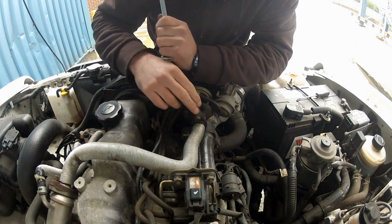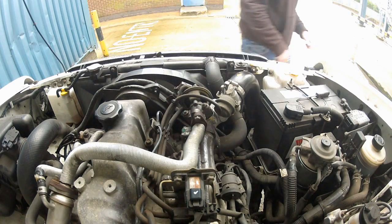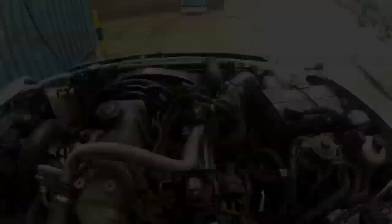Right, that's about it. And now you're preventing all the sooty exhaust gas from re-entering the inlet manifold. Congrats. You may even notice a slight improvement in engine performance too, which is always a bonus. Now, one problem you may encounter if you're doing this to a more modern vehicle is that the fancy onboard computer system is going to know you've done this and may well trip an engine light on the dash. The only way around this, I believe, is to remap the ECU, which may make this modification more hassle than it's worth. But if you've got an old rig like this one, as far as cheap and easy modifications go, it don't get much better than this. So, see you next time.